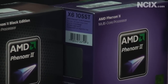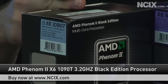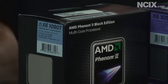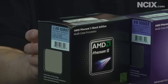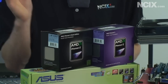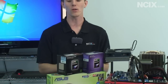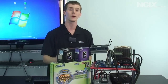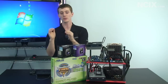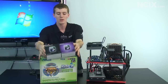If the overclocking we went through looks like too much work, you can also go with a Black Edition. AMD's Black Edition processors are still under $350 and feature an unlocked multiplier, and they're faster to boot. This is a 3.2 gigahertz processor that goes up to 3.6 in turbo mode with only three cores active. Unlike Intel's six-core unlocked processor, it costs about a third of the price, and although you don't get quite the same performance, it's a great value and easier to overclock — all you do is change the multiplier and turn up your CPU voltage a little bit to offset any instability.